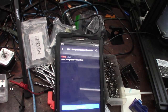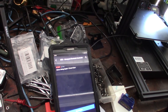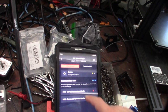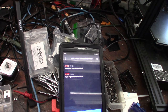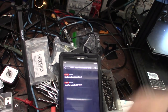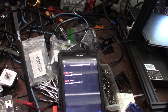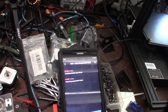One of the codes is for the occupant restraint controller — driver airbag squib. That's exactly what I wanted to see. The other two codes are headlamp switch input circuit and fog lamp switch input circuit. I think those are related to what I covered in my last video where the turn signal switch was all messed up — they may be part of the same circuit.